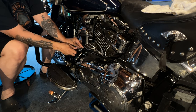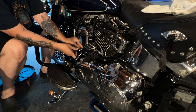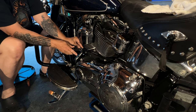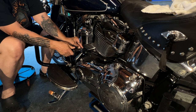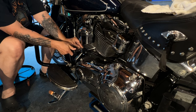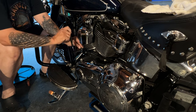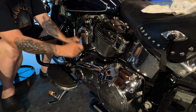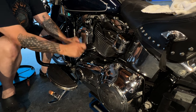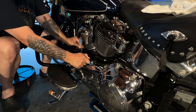I have a half-inch torque wrench, a three-quarter torque wrench, and a quarter-inch torque wrench. The quarter-inch is mainly for smaller bolts — you'll snap those with the bigger one. I actually really love this, Dad. I love working on these bikes. To me it's not work at all — it's fun. The only time it feels like work is when a bike's really dirty and greasy. But where I really start loving it is when I get to start putting everything new back together on it. That's when I have the most fun.